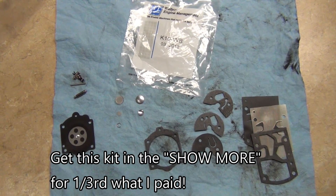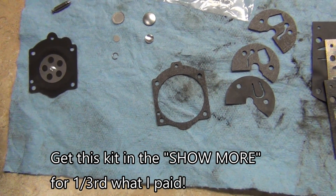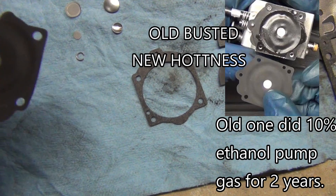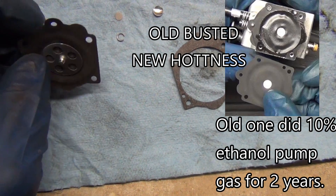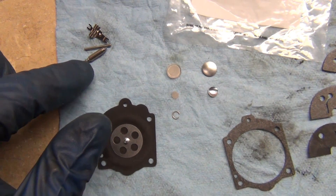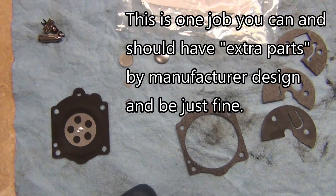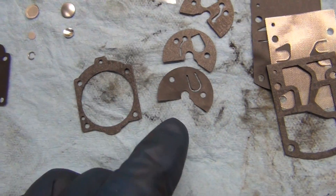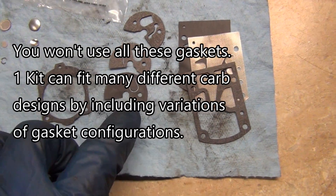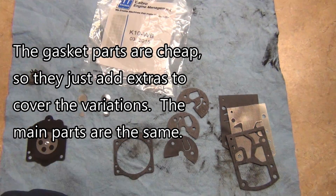So whenever I do a carburetor like this I'll get the kit for it. In this case it's a K10WB. I just lay everything out. You've got your diaphragm — if you use pump gas with ethanol in it, you'll find that your diaphragm gets worn out, it basically just gets all floppy and soft. These are your fuel screens or fuel strainers. This is your needle for your needle and seat. That's the rocker. That's the crossbar for it. There's a little screw that holds a bar and all that in place. And then there's all these different gaskets — I just lay them out by similar type so as I'm moving through the carburetor I can just grab from this pile and everything's pretty organized.